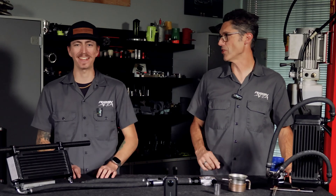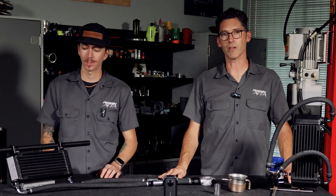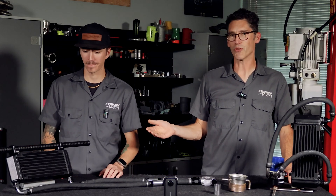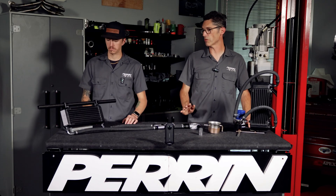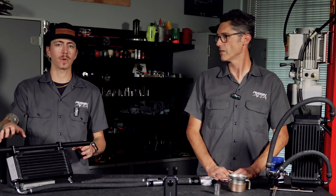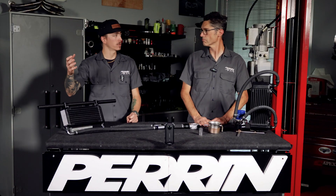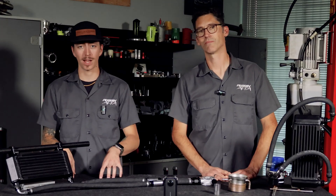You can see just on the table that the standard hoses are twice as long. The top mount utilizes the hood scoop and makes it functional again. This is specifically for cars with front mount intercoolers — it won't work for cars with top mount intercoolers since it occupies that same space. If you have a top mount intercooler, get a front mount and that solves the issue. When you buy a front mount your hood scoop becomes useless, so this oil cooler makes it useful again. The install is roughly an hour versus two to three hours for the front-mounted cooler — a huge benefit.